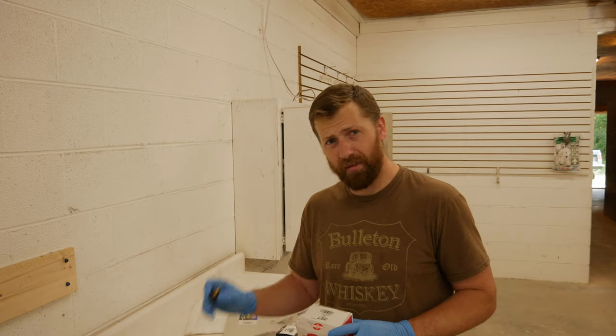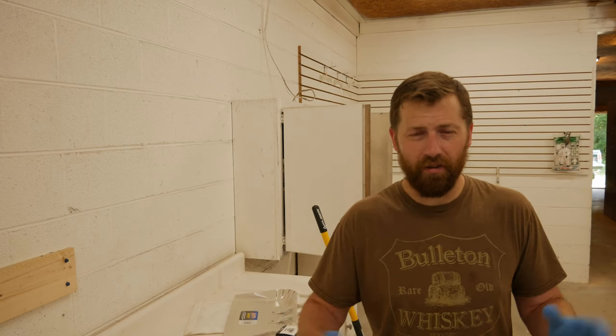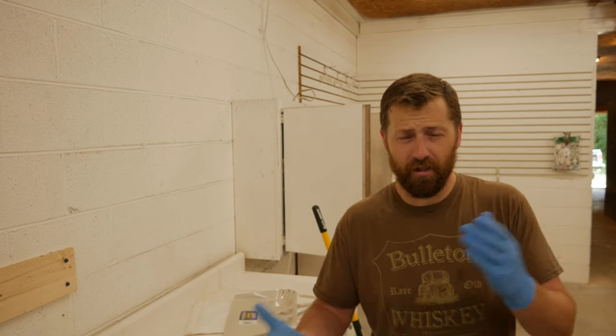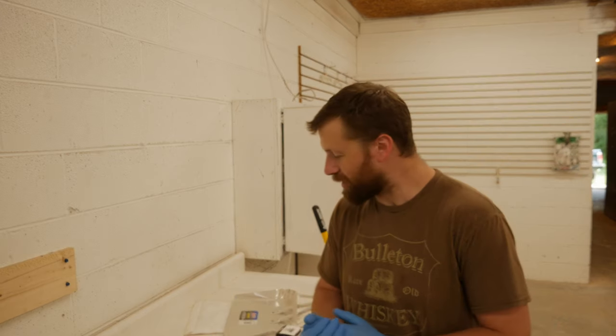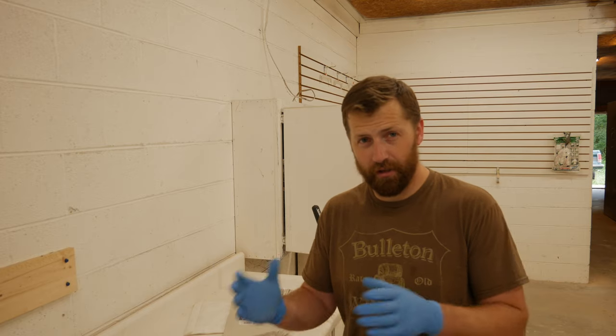That's kind of what happened with the distributor cap and maybe the rotor. They have a lot of parts listed. I'm buying parts for a 1970s Mazda — I think it's like B1200, 1600, 808, or some early 70s Mazda four-cylinder. This thing is like 1,398 cc, so you have to find something within that family. There's a lot of crossover parts that are bolt-on accessories, which is what we're dealing with right now, ignition component-wise, and a distributor cap is one of those things.